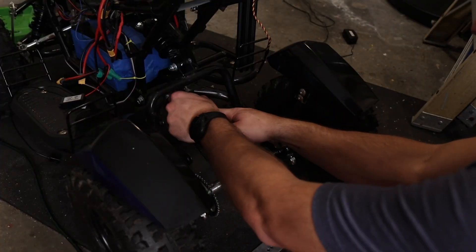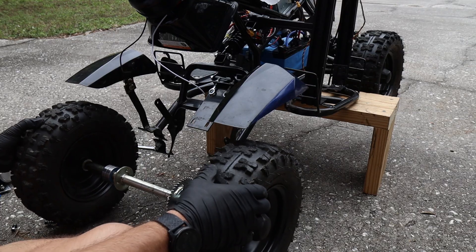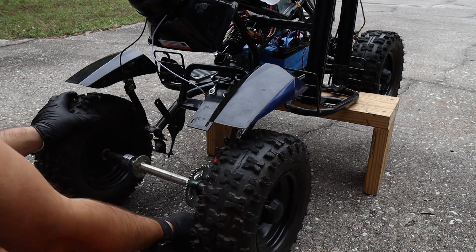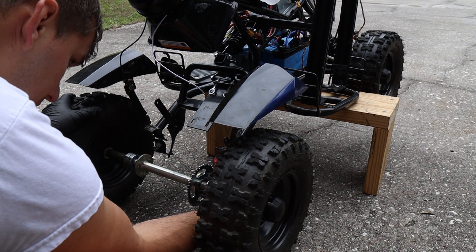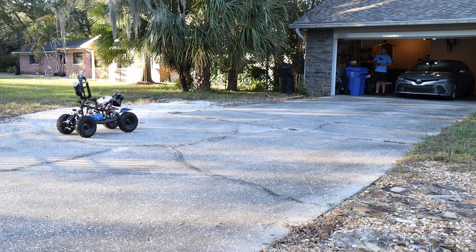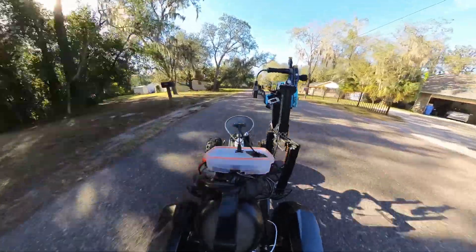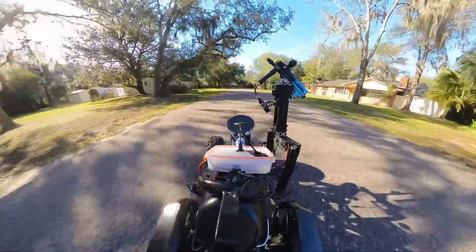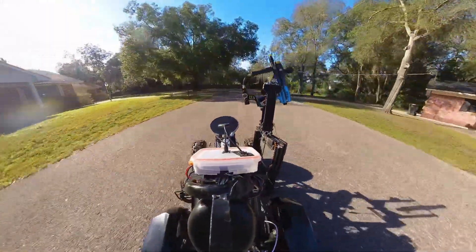Since the motor mount was designed with the gearbox offset in mind, I had to create an adapter to mount the new motor. I also had to swap the rear sprocket since the new motor uses a different type of chain, but that gave me a good opportunity to remove the unused brake rotor and swap out the old bearings. The new motor is quite zippy — I didn't really consider how small my front yard is before the upgrade, because now this thing is ridiculously fast and runs out of driveway very quickly. My road doesn't get much traffic so I started speed testing there instead, which was a little sketchy because the steering became touchier as the bot got faster, but thankfully all of my neighbors' mailboxes remained completely unharmed.